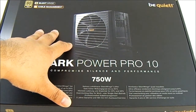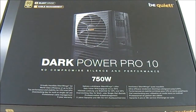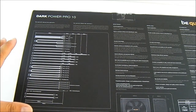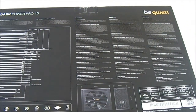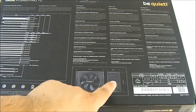You have the 24-pin power permanently attached to the power supply itself, but it has modular cables for the other connectors. The Dark Power Pro 10 comes in a variety of wattages — this one is a 750W model, you also have a 550W. The 550W all the way up to 750W uses an updated FSP design, while the 850W and higher models use a Seasonic design.